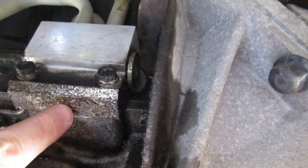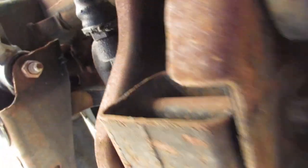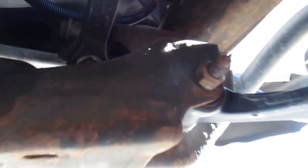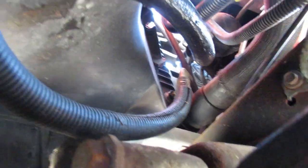The other thing I wanted to talk about was the oil cooler lines. You get two issues: one is that it leaks where there's a little gasket, which is pretty easy to fix. With a two-wheel drive van you can also replace the hoses, because the hoses are known to leak where they transition from the steel line to the flexible hose. It looks like the transmission lines are leaking up here too because the lines are wet — there's no real reason for them to be wet.